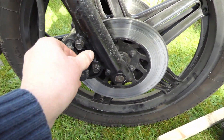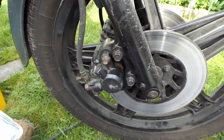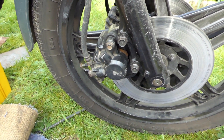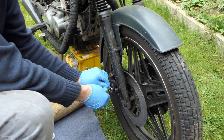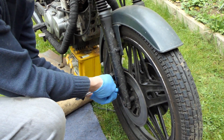What I need to do now — I've started undoing them and I'll probably have to prise that off. These are the new seals that are going on. I'll set the camera up and then we can have a look. The two bolts that hold that on are just 14mm, so a 14mm spanner to take these off. Because it's sticking, I'm probably going to have to prise it off.